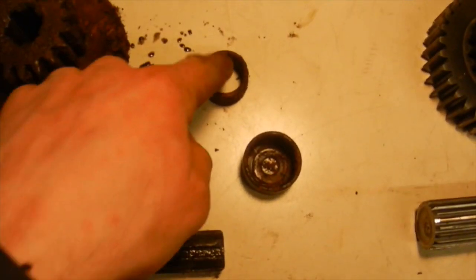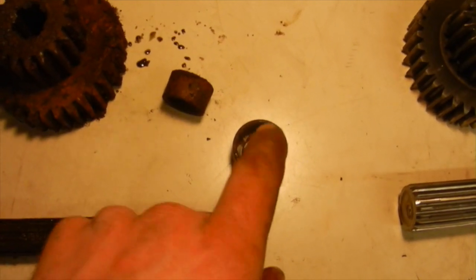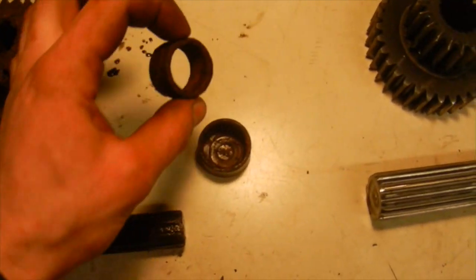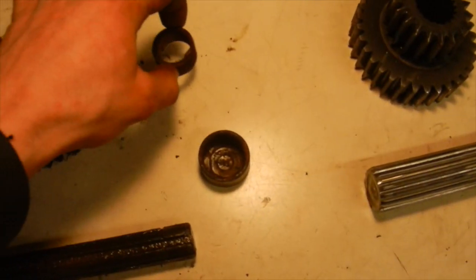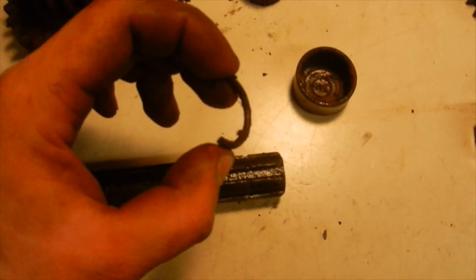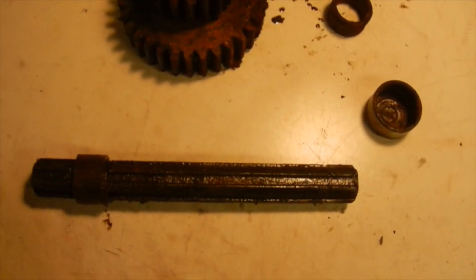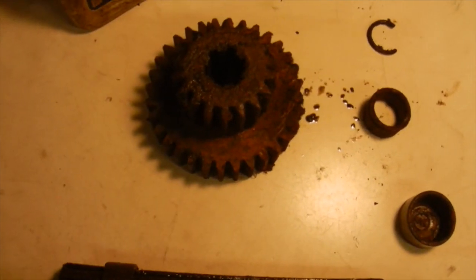I'm also going to need these bushings which go on the end, which allow this shaft to ride in the bearing cup — I have a good one of these in the 195 transmission. I have two bushings on this shaft, one here and one here that I got in the box. I believe they are the same size, so I won't have to worry about getting those. The only thing I will have to look for is these clips that go on the ends here and here. This one kind of broke, but they're just round — they're like a snap ring, only there's no ends with holes on them. So I'm going to have to round up a couple of those. But I'm going to get this thing cleaned up — some wire brushing and some scraping — and see if we can get these things to clean up nice to go back in.